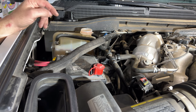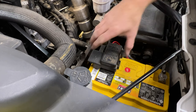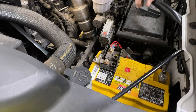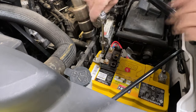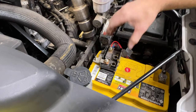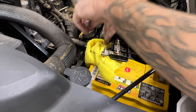I'm going to disconnect both batteries because we'll need to take off everything on top to access the tank. On the driver's side, go ahead and just disconnect the positive — this just snaps off — then grab a 10mm and loosen the terminal. Pull it off and stuff a rag there so it doesn't touch anything.